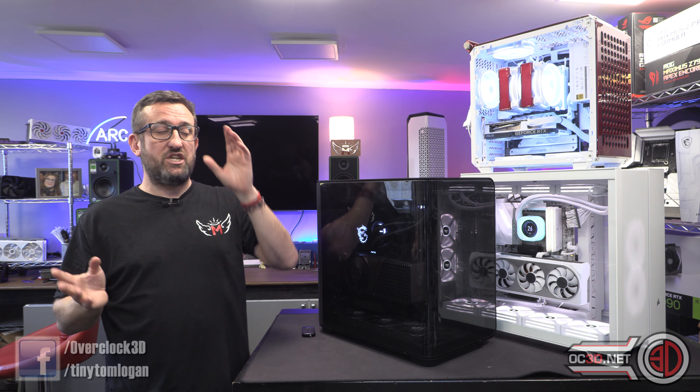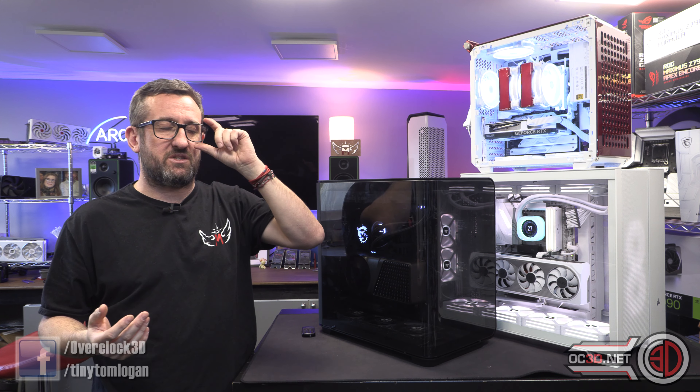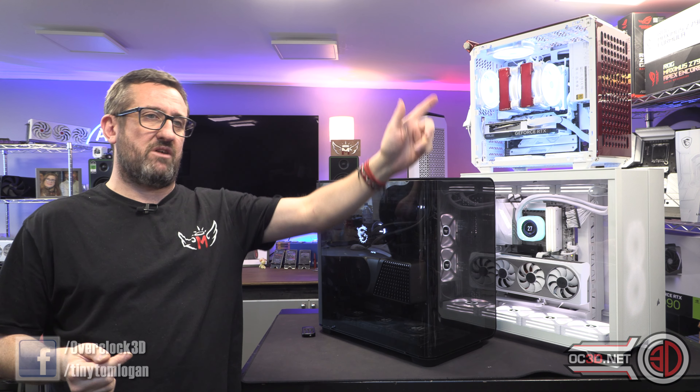Long term they should be fine, but one of the reasons I wanted to teach you how to fish is that in a year or 18 months' time you might find your system is a bit unstable when running Cinebench 24 — and it might mean you need to give it just a smidge more volts. Over time silicon can degrade — this is one of the reasons voltages are so high from the start. But you now know where the settings are, how to check them, and you know to keep an eye on temperatures and clock speeds. You might also upgrade your processor in six months — you'll know how to go through the whole process again.